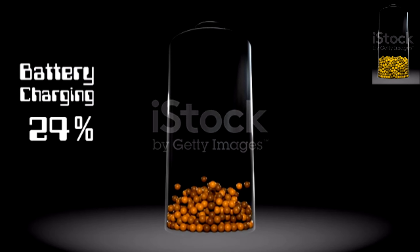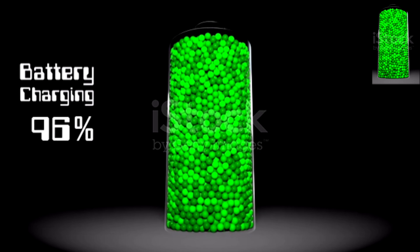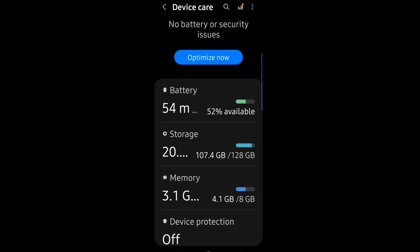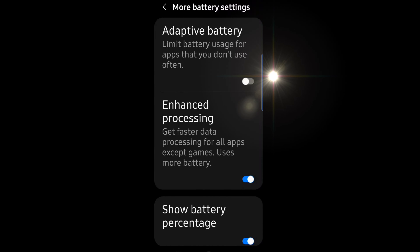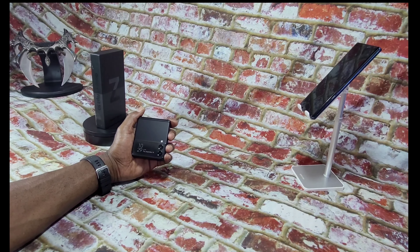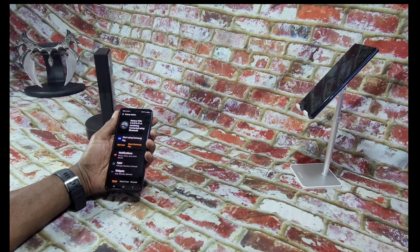The infamous battery — the device has a 3,300 mAh dual cell. Despite all of the negative feedback the battery has received, I think these new battery options are long overdue. The battery has different settings that will help you extend the duration of each power cycle, as well as the overall life of the battery. Open your Settings menu and click Battery and Device Care, then select Battery. From here, you can activate your power saving feature. Under More Battery Settings, you can activate the adaptive battery function as well as Protect Battery — when active, the battery will not charge beyond 85%. Hopefully the Flip 4 will level up to a 5,000 mAh power cell.